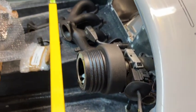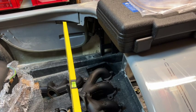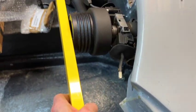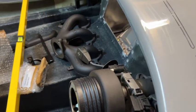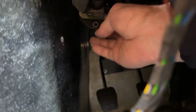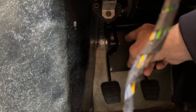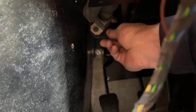I've got the wrong steering boss here, but I'm pretty pleased that when lined up the column intersects almost the same point on either side of both doors, so the steering wheel is going to be nice and straight. Once you've adjusted it so the steering column won't hit anything when it turns and the rest of the column is inserted through to the hole at the back, you should be good to go.